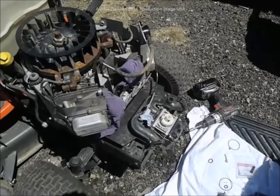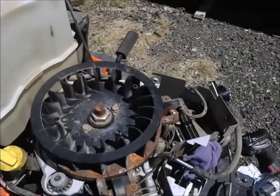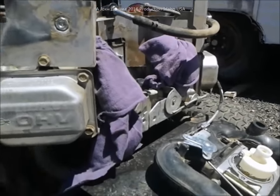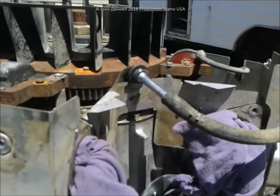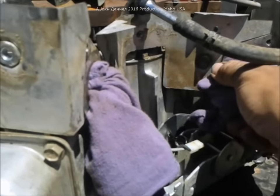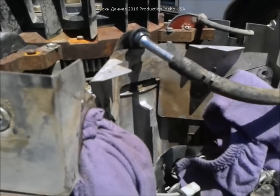This is a 22 horsepower Briggs & Stratton — she's got 576 hours on her — and it is a 22-horse Intek motor, model number 441777. Many of these are going to be alike because they use the same style carburetor. This is the same style manifold and carburetor you're going to find on most of the V-twins in the Intek family from about 18 or 20 horse on up to about 25. I've plugged off my intakes on both sides with rags so I could use air to blow this out and clean it.